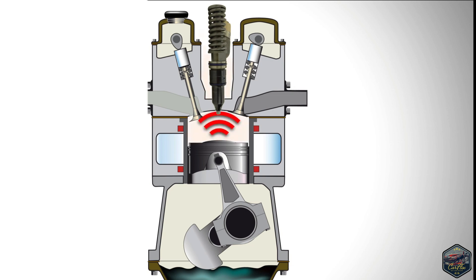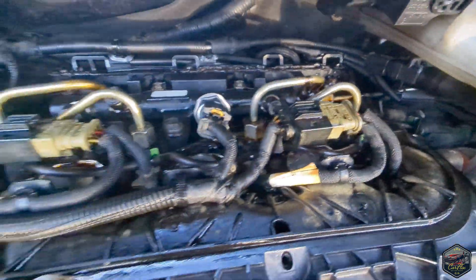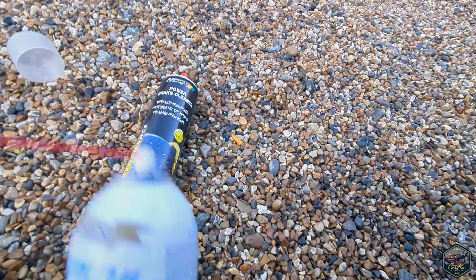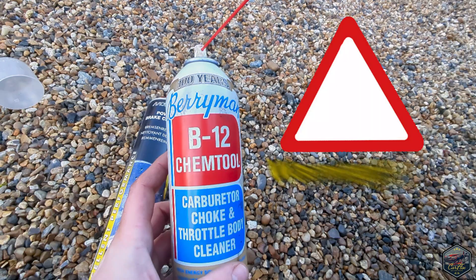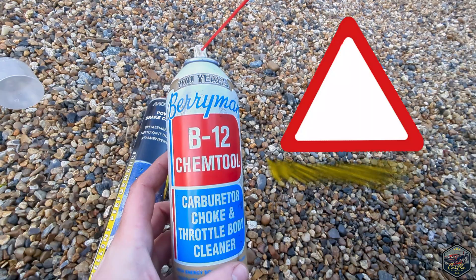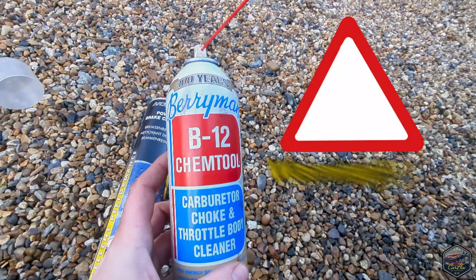So let's get this cleaned off and get fixing this. I've cleaned it up the best I can and it has come up really well. For reference, brake cleaner does absolutely nothing for this kind of stuff — you want carb cleaner. Any carb cleaner will do the trick, but don't spray it directly onto everything. Put it onto a cloth and then wipe everything down, otherwise it liquefies and goes down into your injectors.